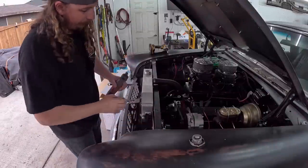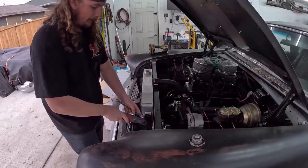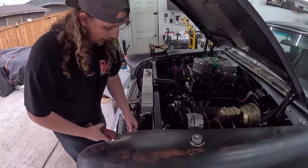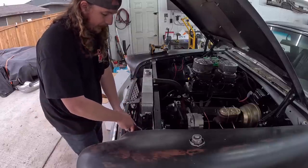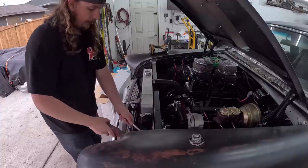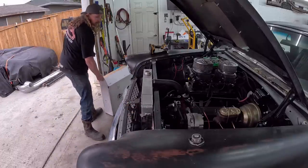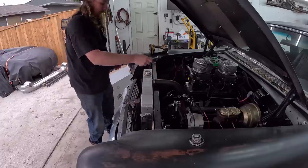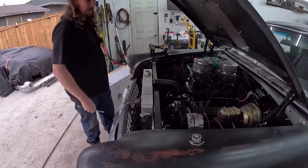Okay, so again, Tri-5 radiators are very simple, and they're good, but I am worried about the extreme heat we're gonna go through. The other radiators probably have to sink down a little bit. These ones bolt in with some little side strapping, so they're very easy to install, as long as you have a decent core support. It has a center mount, or center out, spigot for the thermostat housing. I did get one that's offset, like a standard Chevy deal.